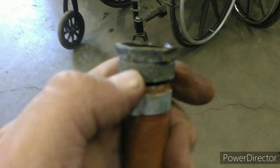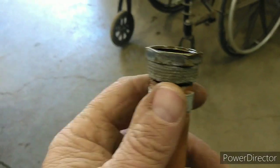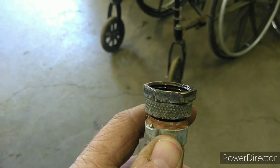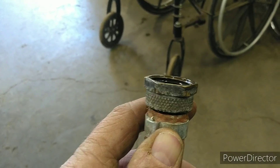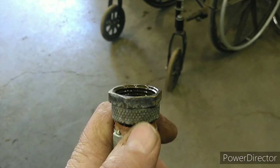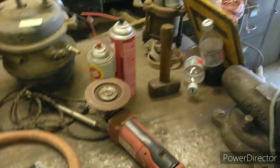The barb piece where it's in the nut is heavy — probably pushing an eighth of an inch thick right here where my thumb is. So when it does get cold, the regular washing machine hoses are just a stamped barb — it ain't even 1/30 of an inch thick. The only reason it holds up is it gets sandwiched in, but those things crack before you even get any ice forming really. We used to fight those things all the time. With these heavy ones, we've actually had it get down 15-20 degrees where I thought those hoses were done because they didn't get shut off, and we haven't had one break yet.